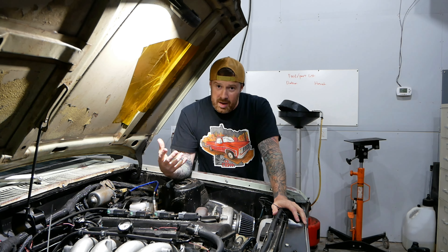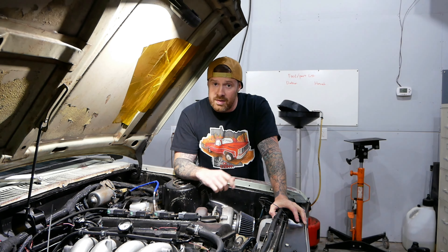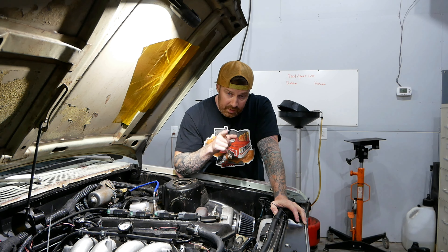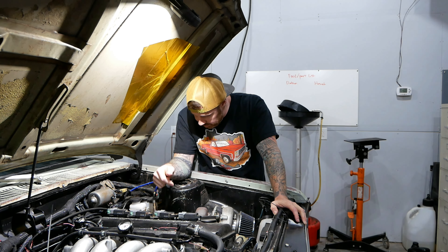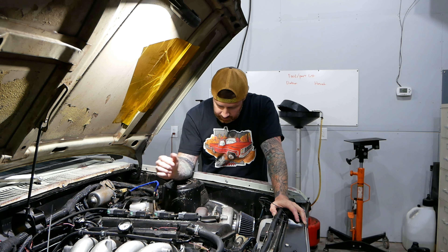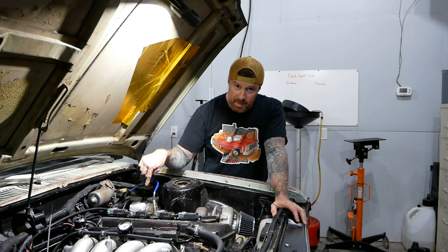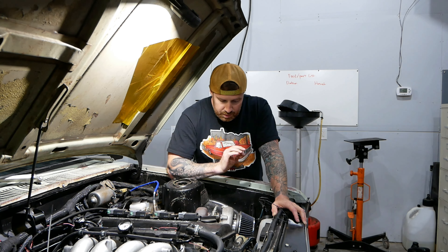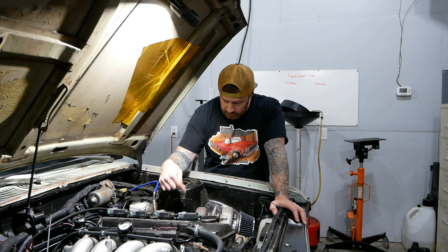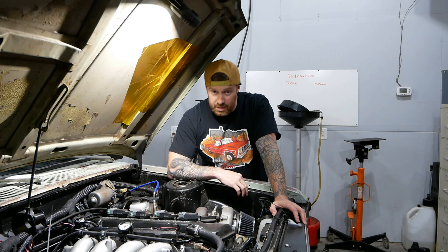The crack on this downpipe got me thinking. I know that when we were on Power Tour, this car pancaked so hard on the highway, probably a dozen times. So it's possible this thing has been cracked for a while. I always thought after we bolted everything back up on Power Tour that we still had an exhaust leak, and I didn't think the V-band clamp down at the bottom of the downpipe was really leaking that bad. That could be part of why this thing has been a little funky to tune.